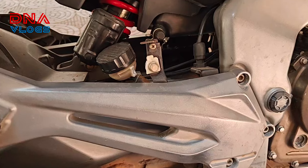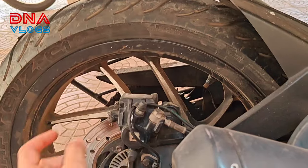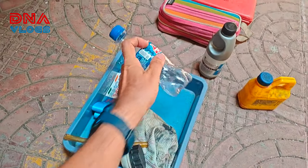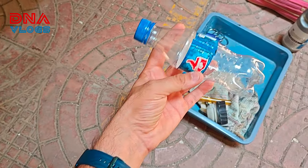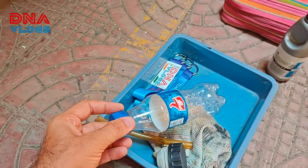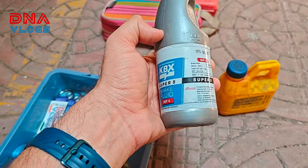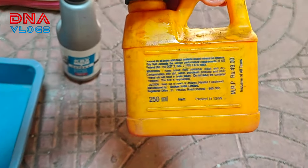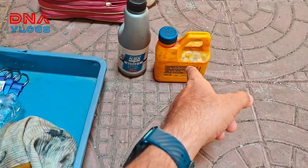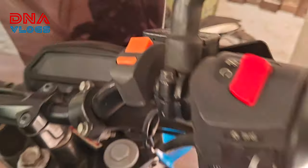When replacing it, there are bubbles in it, so we will have to do a bit of brake bleeding too. I have got a spare pipe for that, and a spare bottle to collect the waste oil. Do not use the oil that comes out of the reservoir — discard it. I've got DOT 4 and a very old DOT 3. I'll check the color inside: if it is red I'll use the DOT 3, if it is golden I'll use the DOT 4.